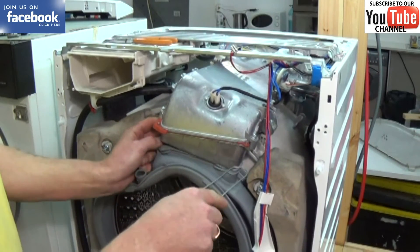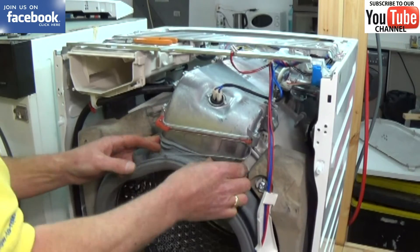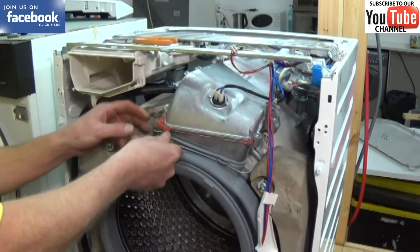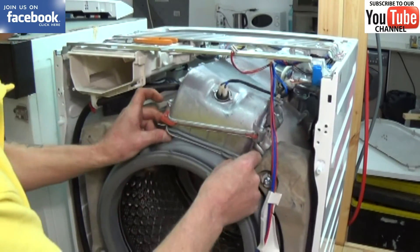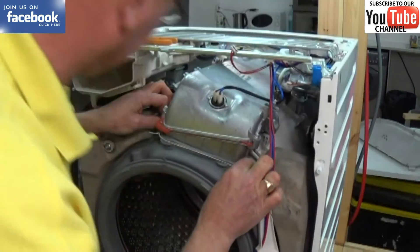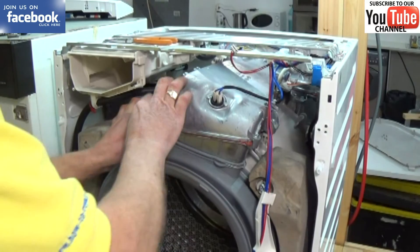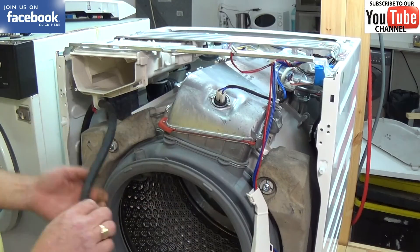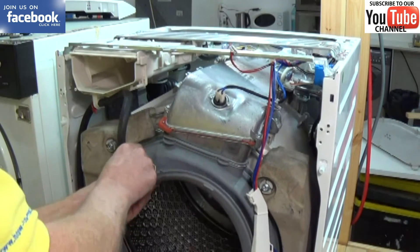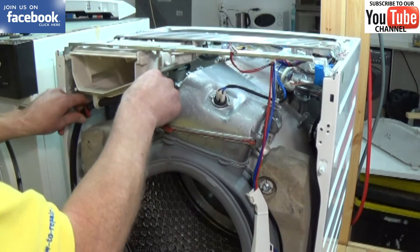Now we've got the block in place and we've also quickly done up the heater. So we just need to peel the seal over the heater and it just slides up on the ducting. Once you've got that in place, you just need to put this wire band back on — it only clips over and you can usually do this with a pair of pliers. Now the pump hose here, we're just connecting to the top of the seal — it only pushes into place. Just make sure there's no kinks on the pipe.